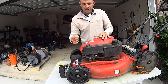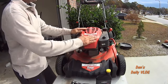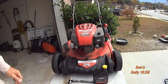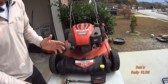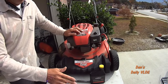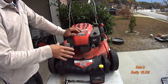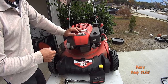That's air — one huge element to making this motor run in tip-top shape. The second element is spark plug. On this particular model — a Briggs and Stratton 190cc Professional Series — the spark plug is right here. Most machines are going to be OHV — overhead valve. That's significant when you go to your local lawn mower shop. If you say 'I need a spark plug for a Briggs and Stratton 190cc' they're going to ask you one simple question: is it overhead valve or not?